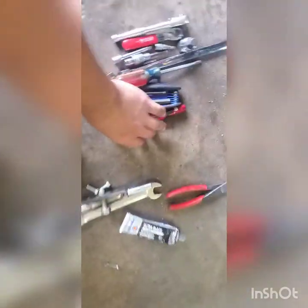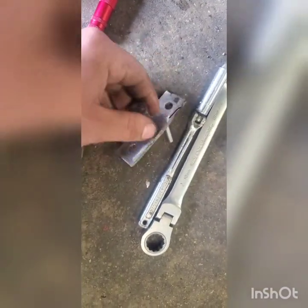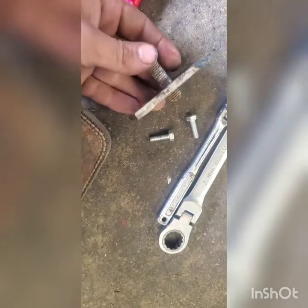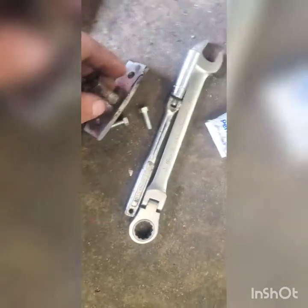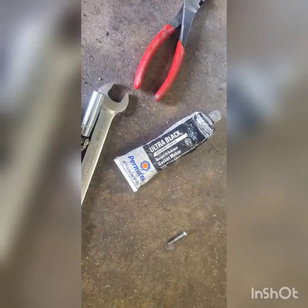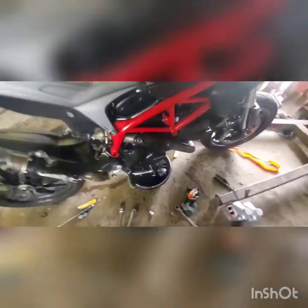Got a light so I can see what's going on. Now this is to remove the cover — you can choose to buy the tool or make the tool. I ended up making the tool. Pretty rudimentary but it works just fine. Got your two bolts going there and something to turn them with. You're going to need black silicone. For simplicity of the video I already changed the filter — filter number KN153. Your drain plugs are right here, one on the side and one on the bottom.